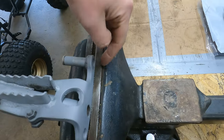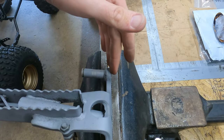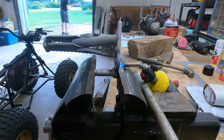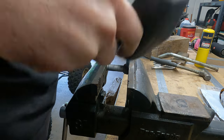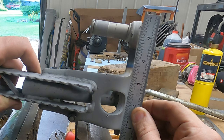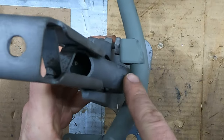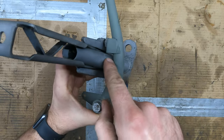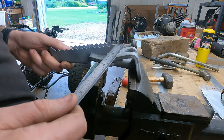So we got this foot pedal now. If I have to, I'm going to heat this up, but I'm going to try to hold on to it real close to where it's bent and then lightly but firmly beat on the back side of this to try to bring it back down. That has turned color, so she is good and hot. I think that looks straighter — getting there, a little more. I think I'm happy enough with that. The brake lever is just primed but it's dry, so I wanted to mock this up quick. This looks a lot better — there's a gap in here now and there wasn't before, and we're actually hitting that bolt now. It's not perfect, but we're definitely a lot better than we were. I'm going to pull this bolt and nut so we can zinc plate that.